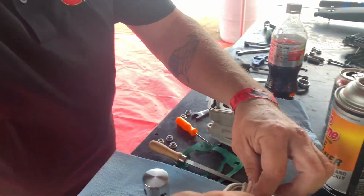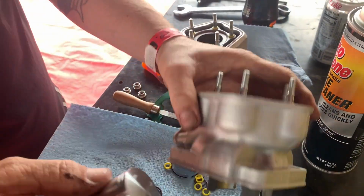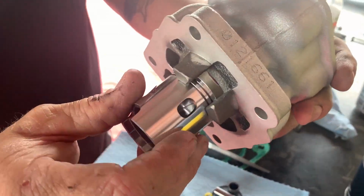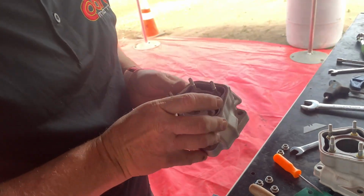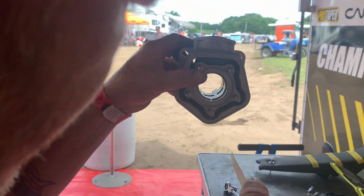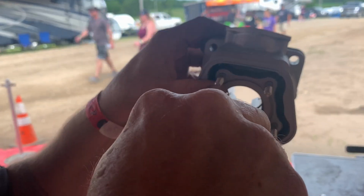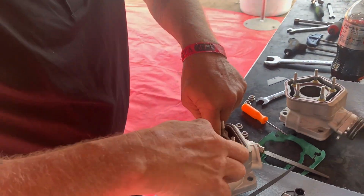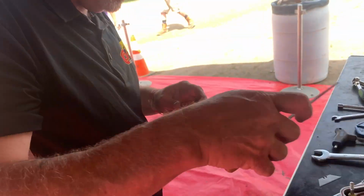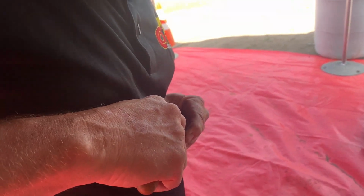So he'll get his ring around, align it top to bottom, push it in there. Now here's the key to this: he'll push his piston up through there and get the ring perpendicular to the bore. So now using his feeler gauge, he'll stick it in that gap and see what he's got. It needs a little love. Take a look as he files that ring end gap.